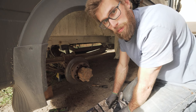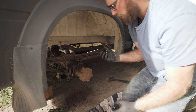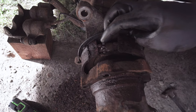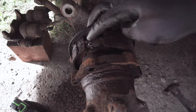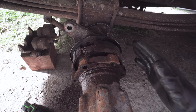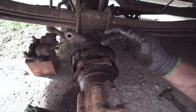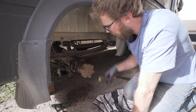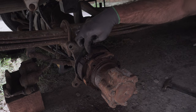After a lot of rotating and banging I got the rotor off. I actually have a seized parking brake — had it on the other side too. This is that gear I was talking about: it's supposed to rotate but mine's seized. These are your brake shoes — they expand out when you hit the parking brake or pull up on the lever, and tighten up on the inside of the rotor. Mine are obviously completely rusted. I'm going to wire brush and clean all this up and take off those old parking pads.